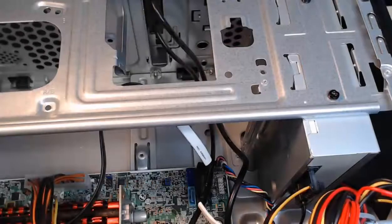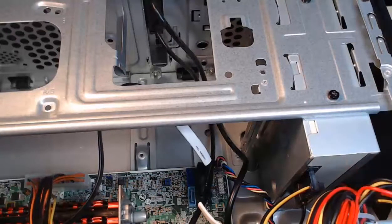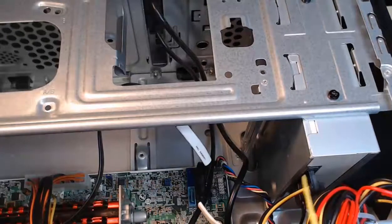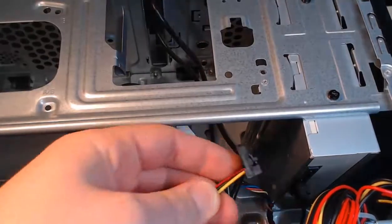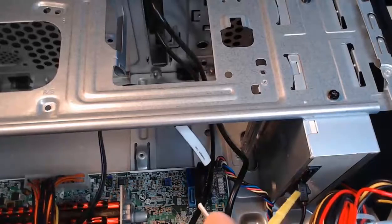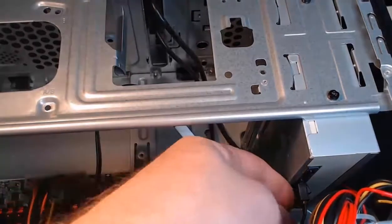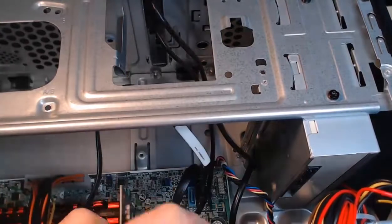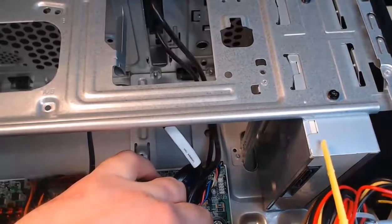Let's continue on and remove this optical drive. We've got the power supply here and the optical drive right next to it. What we're going to do is remove the SATA power connector from our optical drive — I can grab it with my fingers right there and pop it out. Right behind that, we have the smaller SATA data connector, so I'm going to remove that as well, just grabbing it and pulling it straight out. So the power and data is now disconnected from this SATA optical disk drive.